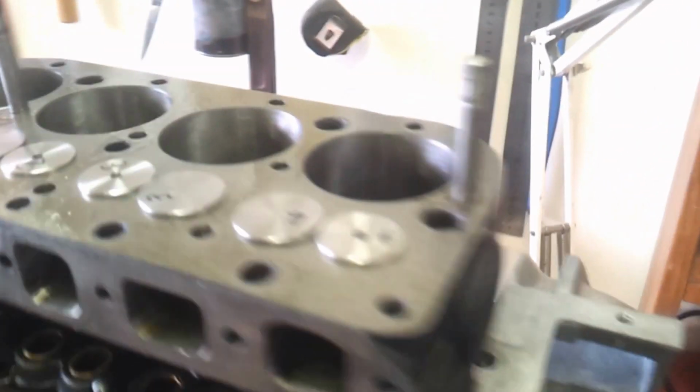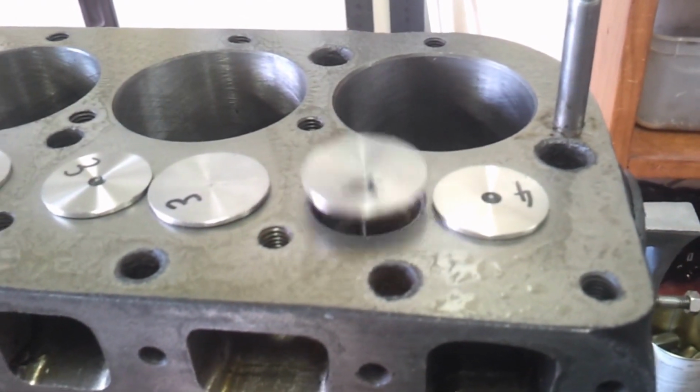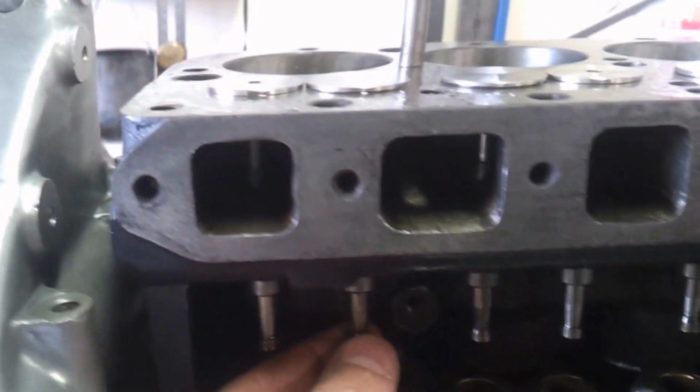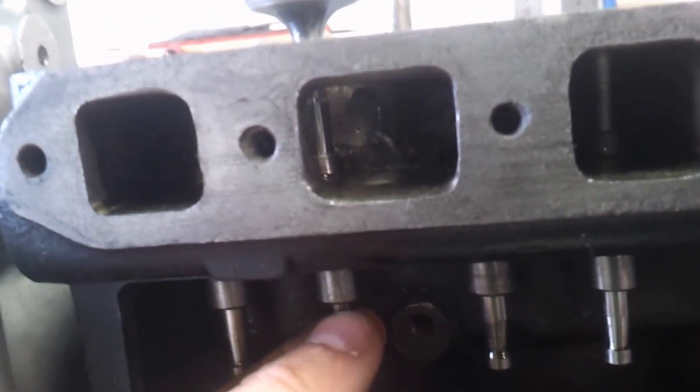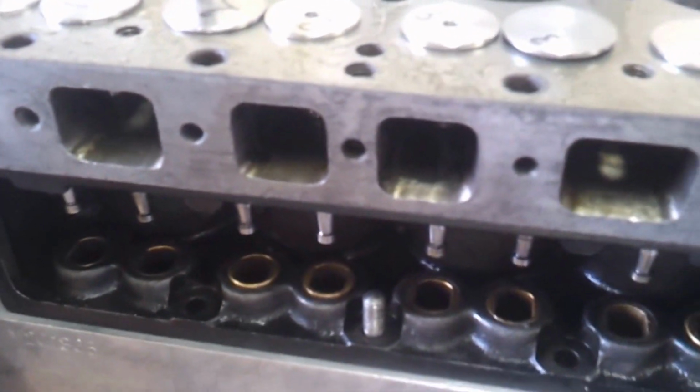The block's been fitted with bigger valves. Ian up in Auckland did that for me. So these are the bigger inlet valves, and he also started porting it for me, just tidying up the port. It's a bit hard to see, but it's cleaning it up, smoothing it out, and removing any little rough spots. Because bigger valves were fitted, you have to grind out the pockets to make everything smooth. So he half did that for me, and then I moved to Wellington, so I've completed the second half. I've just copied what he did and tidied all these up.